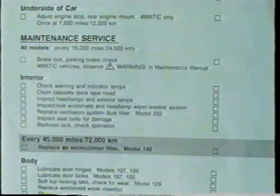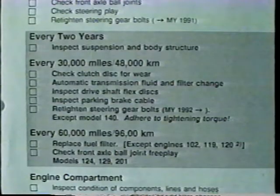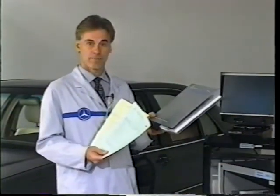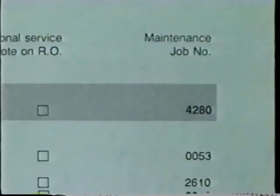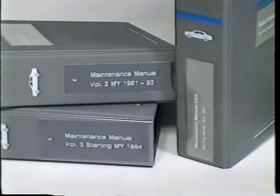Lubrication services are basically an engine oil and filter change with a few minor additional jobs. Major maintenance services are performed at 15,000 mile intervals and involve a major inspection and service of the vehicle. At specified maintenance services, additional jobs are required. These jobs are dependent on the time or the mileage, and they're highlighted in the shaded areas on the form, such as replacing the brake fluid every two years, or additional jobs performed every 30,000 miles. These additional jobs will be noted on the RO, or possibly identified directly on the maintenance sheet. The maintenance sheet and maintenance manual tie together through a column with four-digit numbers. For example, engine oil and filter change is job number 0101.